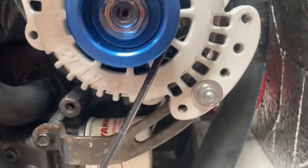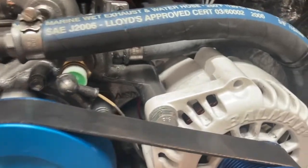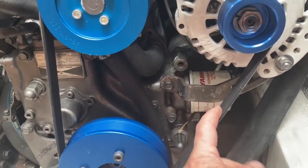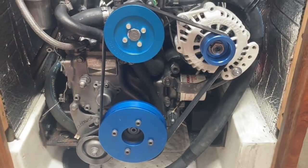The temporary bolt is in. I've tightened up the alternator support bolts and screws, and the amount of deflection I'm getting is reasonable. I managed to get some half-decent tension on it, so theoretically it's ready to go. Some people would think what I just did is a pain in the butt, and in many ways it is. But part of this is therapy.